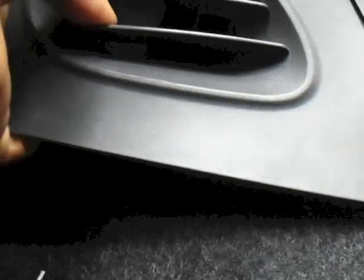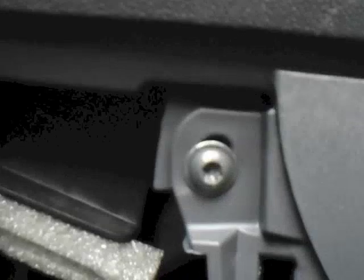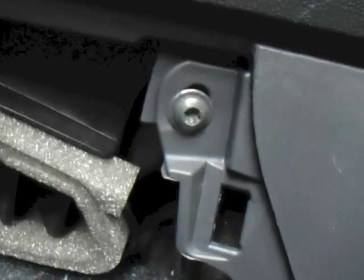Around the passenger side now. I've undone those bolts — back one's out, middle bolt out. There's chewing gum round the bolt, which is lovely. It's quite dirty so once it's out it's easy to give it a good clean. Down here we've got one bolt which holds on that panel and one screw that holds on that panel. Once that's undone there are screws down here. There's another screw which holds the centre console onto the top bit, and there's a similar affair around the other side.